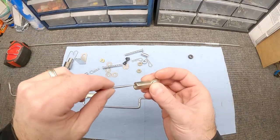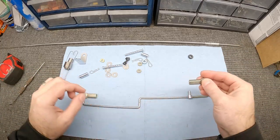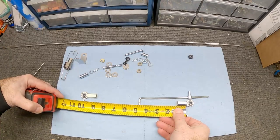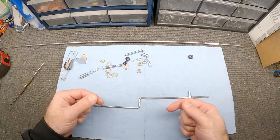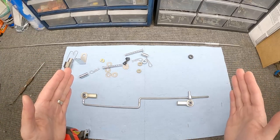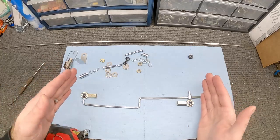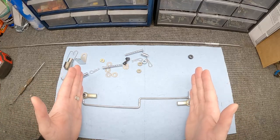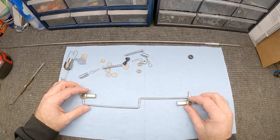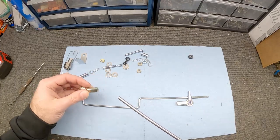To get the inside length of the rod end — it's roughly an inch deep — so I know it's an inch from here to there. This needs to be 11 inches total, which means the rod can't be longer than about nine and a half inches. I actually want it as short as possible because making it longer drops the pedal to the floor. So I'm going to cut this at nine and a quarter inches, then thread the ends with a quarter-28 thread pitch.